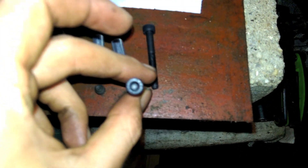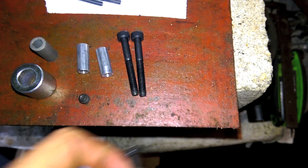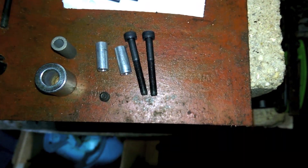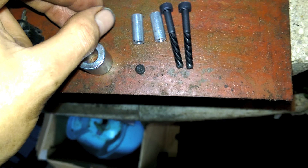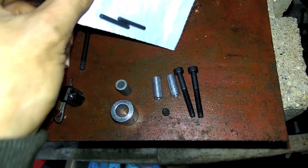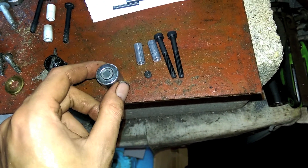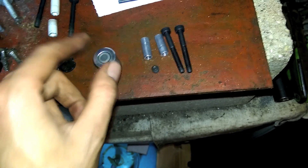Here are the parts I picked up from Ace Hardware. I went with Allen head cap screws because their head is thinner — not as wide as Torx — so I can get these bolts closer to the sensor for a straighter hit. We have some aluminum spacers, a thick one and a thin one, a set screw, and 1/8 inch tension pins. My plan is to have this inner collar mate with the TPS, then use the set screw to hold the bigger shaft to the smaller shaft. The tension pin will stick out and allow us to adjust it — so even if the hole is off, we can still fine-tune it later.